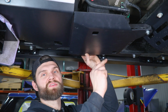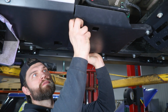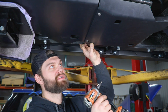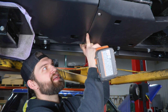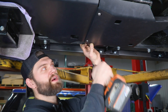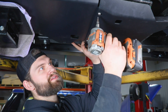With the front bolt installed and supporting most of the weight of the skid section, come to the back and install those 5/16ths button heads into the clip nuts on the rear section of the skid. You'll need a 3/16ths hex — either a hex driver on an impact, a conventional Allen wrench, or a T-handle. Work to line up both halves of the skid by looking at the back edge and how it aligns with the bend line on the rear section, as well as where the bolts line up in the two slots, making sure everything looks nice and even. Once you're happy with the alignment, snug those two up.